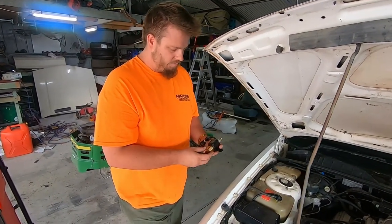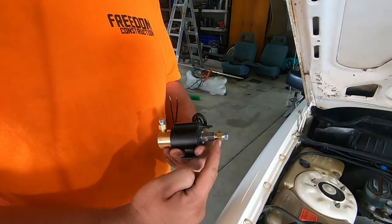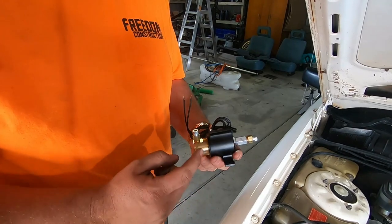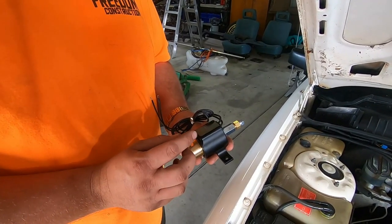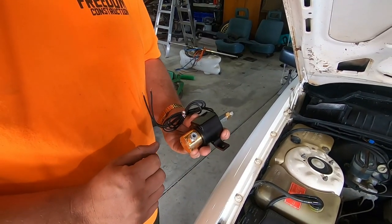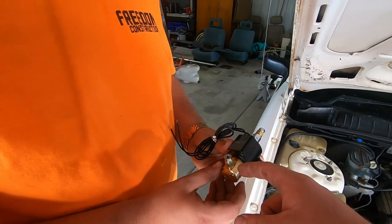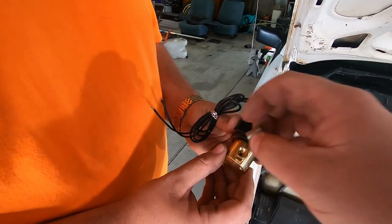And yeah, it's pretty much good to go. We had to buy these fittings separately, I'll put the part number in there, to get the ball flares back in, because it's just an 8th MPT otherwise. So this goes from an 8th MPT to a double flare.